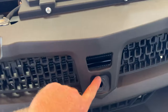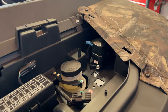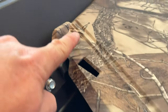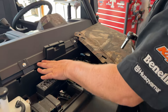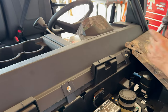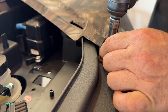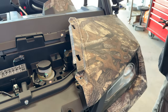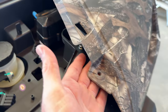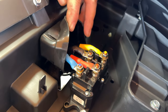Now we've got our hood removed out of the way. Remember there are three grommets here — just pop that out — and there are some notches here. Just pop these out and slide back, lift it out of the way. Then we're going to take this bolt out. The instructions also say to take these two out — that's just to make some room to be able to run some wires. These are 10 millimeter bolts. You do not have to completely remove this side; you can gently pull up here and access the solenoid where we're going to be tapping into for some power.